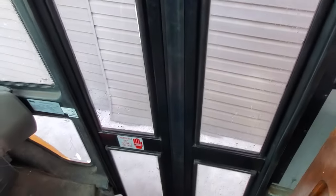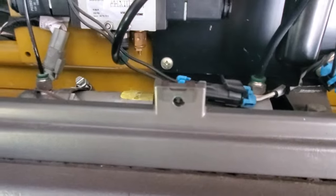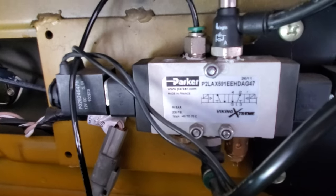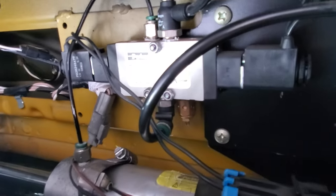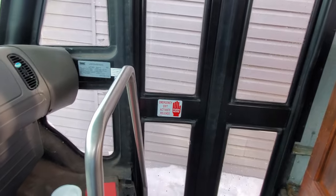I've always wondered why the doors pulse when they close. I was up here looking and found an air leak. This fitting right here — when the door closed, I wasn't sure where the main airline was, but I had this off and it was actually loose down here, so I tightened it up. Now when I go to close the doors there's no loud air noise.